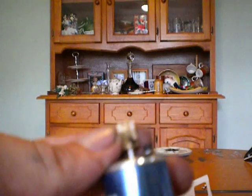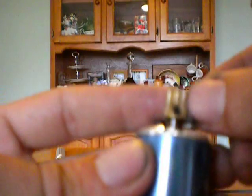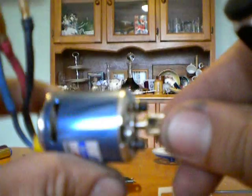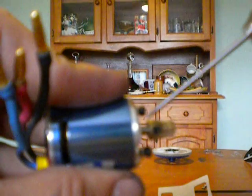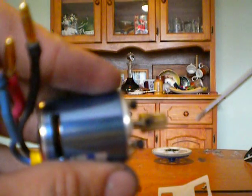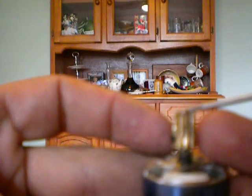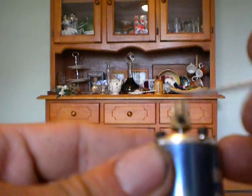Now when you get your first new motor, you've got this pinion on it, that drives your main gear. In that pinion you'll see a little grub screw in there, nice black grub screw. Now you slide your pinion down. Now on the Align motor, you want a little bit of the shaft sticking through over the top of the pinion or flush. Different motors are different with different length shafts.